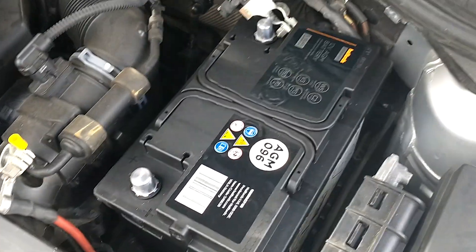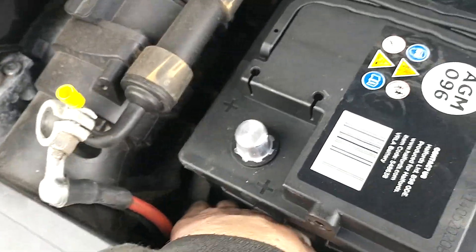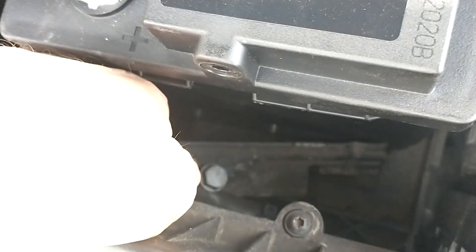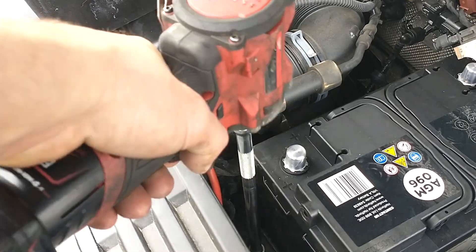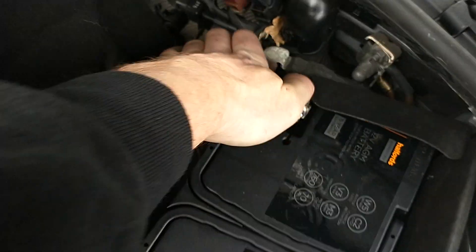The terminal is back off for a minute. Before I put the blanket on, I'm going to have to put the clamp back into place. Put it in there and twist it on by hand, then get our extension and tighten it down. Put our blanket on, then press down our negative.